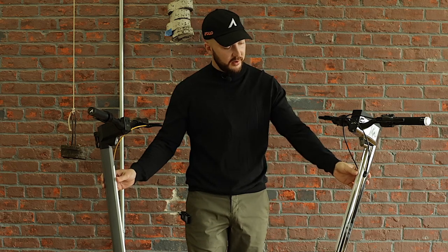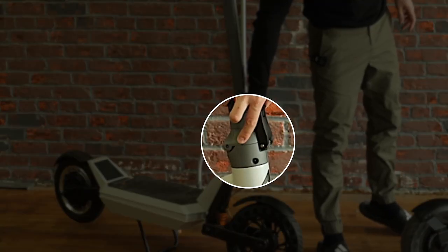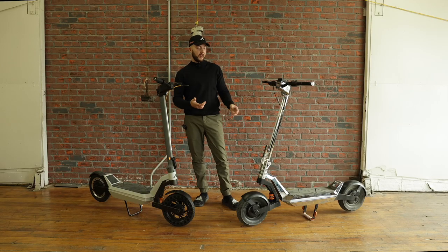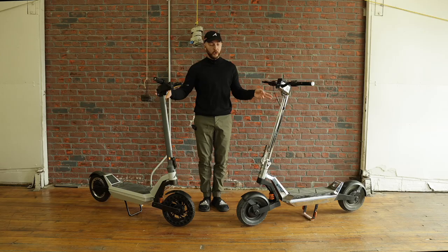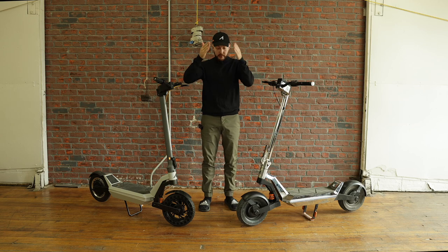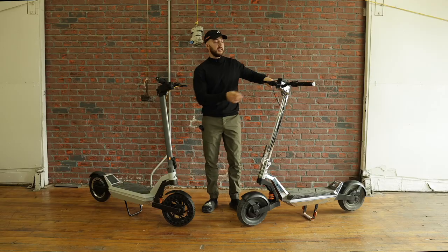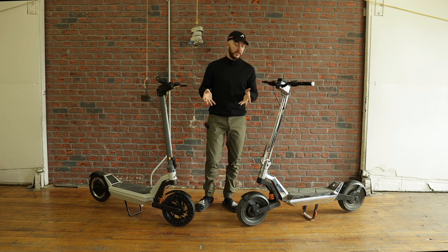Going up, the stem is also different in shape and construction. On the V1 the folding mechanism was screwed to the stem; on the V6 it's welded, which prevents any cracking at that level. The way the headset is fixed to the stem also changed: on V1 through V5 it was only two screws at the back like on the Air in the City, but on V6 we added four screws on the actual chamfer — the angle of the stem — which keeps the head tight to the stem. On the V1, after maybe 1,000 kilometers, looseness would develop.